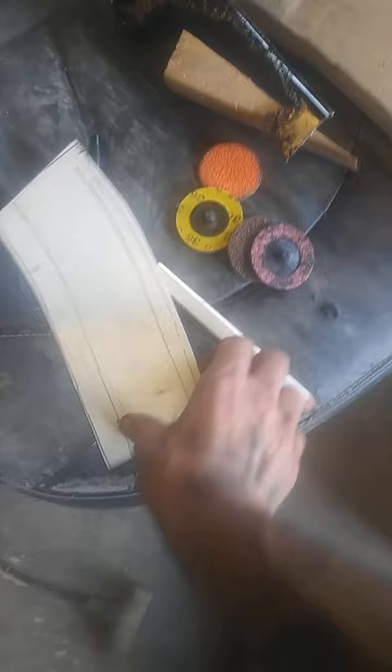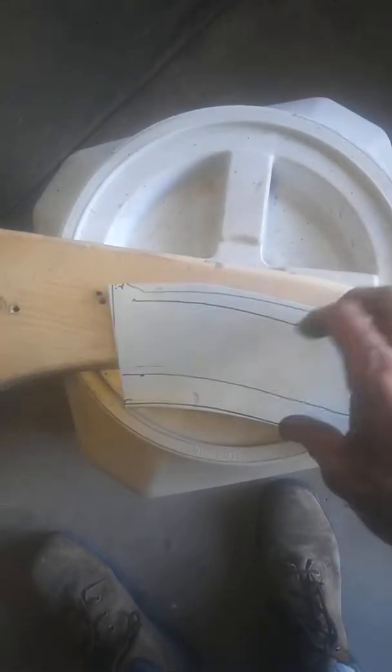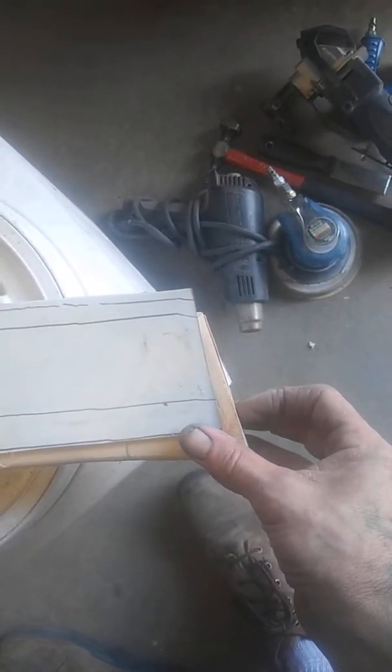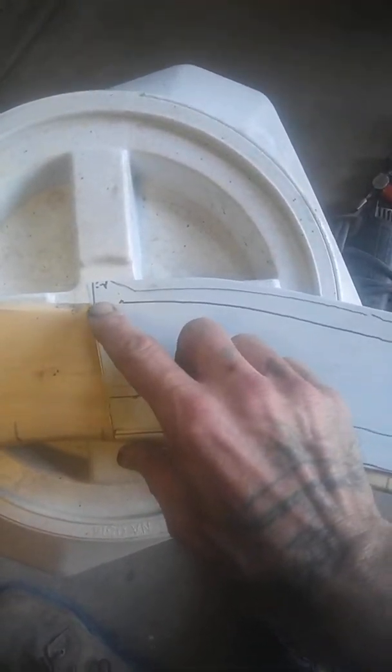But you can see this radius here, I just sand it there, get the shape I need, and I hand beat all my rust patches and make them big, of course. So when I put this piece in the jig, if you want to call it, I'll put that end on that line, that end on that line, and beat that over. Then I'll hand beat that, and then back here for that inside, of course, I haven't buried yet. All kinds of boxes of stuff around.